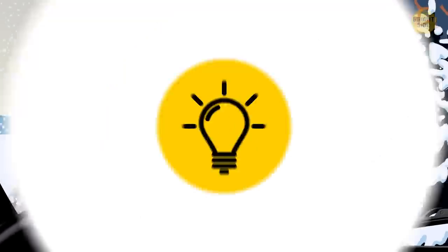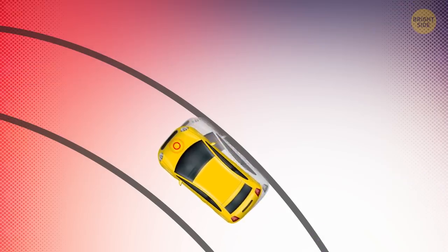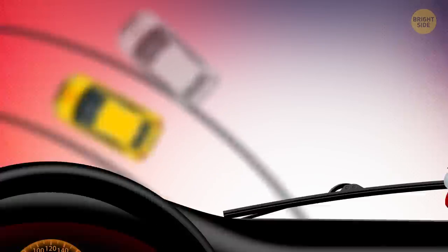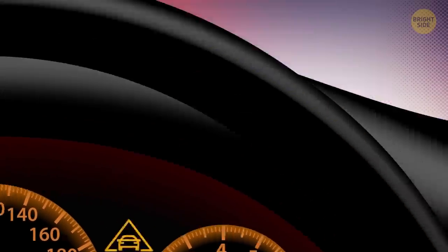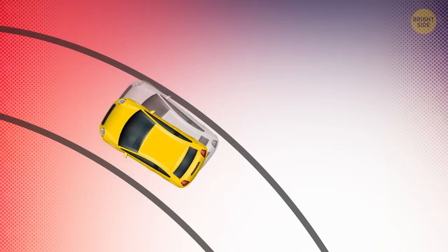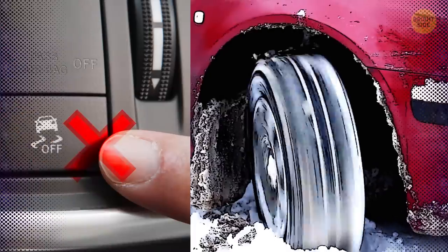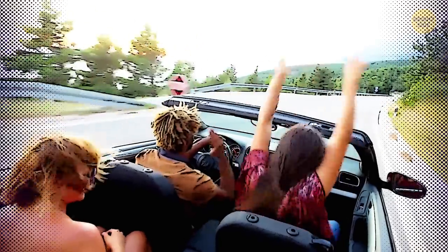Hey, maybe they'll shoot you a little shock into your seat. Stability Control: when sensors decide your vehicle is about to spin out or isn't turning far enough, a little skidding car icon lights up on the dashboard. Stability Control helps you stay stable on the road when it's wet or icy. Don't turn it off unless you're stuck in deep snow — at all other times, it's a real lifesaver.